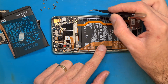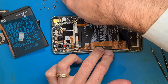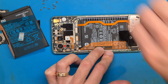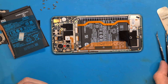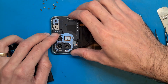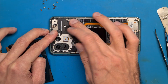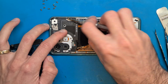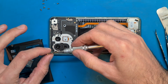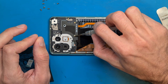Let's get this antenna cable back in its place because we don't want it flying around. Apply just a little pressure to get it into that groove, that space. Get the plastic shield, align it, place it in the top area, push down, and secure it in place using the screws. These are Philips screws and we are using a 1.5 x 25mm Philips screwdriver.